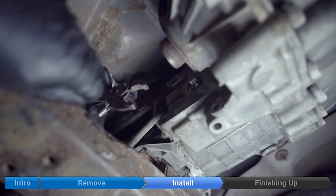If you're having any trouble manually setting the transfer case to neutral, there is one other trick you could use. Before you install the transfer case encoder, plug it in to the truck, set it down on the cross beam — don't install it yet. Then get in the truck, start the ignition, and whatever gear the transfer case was in when the motor failed, tell the truck to shift into that gear. So if the motor failed in four high, plug in the motor, get in the truck, and shift to four high. That'll shift the motor to four high, and then when you go to install it, it should align with that shaft.